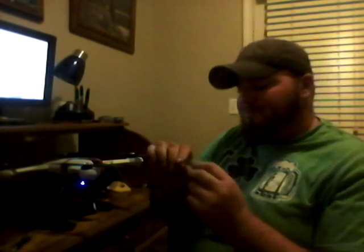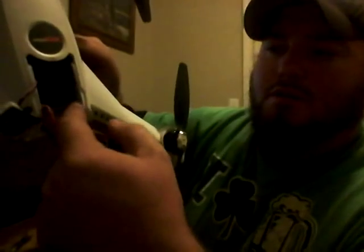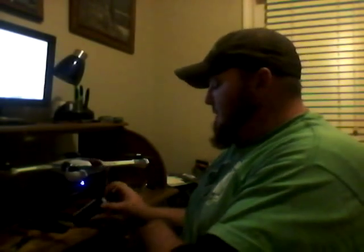So I'm going to run you guys through what it takes to update your firmware on your QX. This is the original QX, which originally came with smart mode, stability mode, and agility mode, before the AP combo came out. What you're going to need is this 350 QX USB multi-rotor programmer cable, part number BLH7840. It's just a USB, it's got three wires, and it plugs into the 350 QX right by boom number 3 for motor 3.